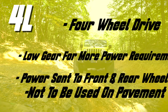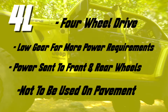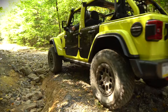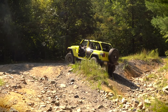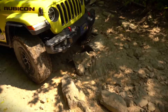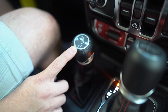Four-wheel drive low is where the Jeep Wrangler becomes the biggest player in the market. Low basically reduces the gear reduction to a maximum speed of about 15 to 20 miles an hour. In my particular transfer case, which is a 4:1, it increases the number of transfer case rotations by four, giving you much faster revolutions but much lower capable speeds. This gives maximum torque and power to your wheels, building RPM and putting it to the ground. Four-wheel drive low is really needed for pulling someone out, severe off-road conditions, or when you're very stuck and need lots of wheel torque rather than wheel speed.